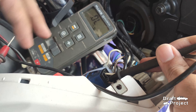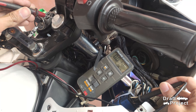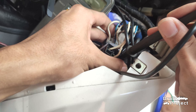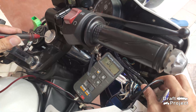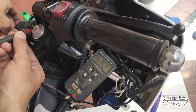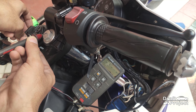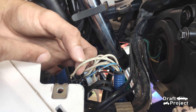With the ignition key turned off, I tap the probe on the wire and place the other probe on the metal parts of the body. Here I found a ground wire. Now I switch to another wire to find out if it is a 12 volt ignition switch wire. And yes, as you can see, it beeps and reads 12 volts whenever I turn on the ignition switch. So I will splice those two wires and use them as my source for the voltmeter.